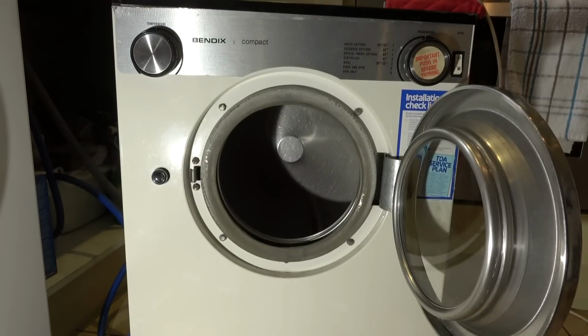And very quick. Obviously I interrupted the cycle to adjust the spin. And obviously the thing is, the quicker it actually gets to spin balanced, the faster the cycle will finish. Because obviously when it's tumbling about and not really spinning, it's taking longer. The timer will always end, but it will just take longer. So the actual cycle time for program 1, for example, is 55 minutes, but can take up to 70 if its balancing is taking too long. Or even if it doesn't balance. You see, you always still get to the end of the timer.